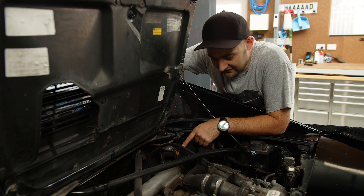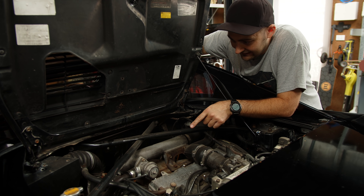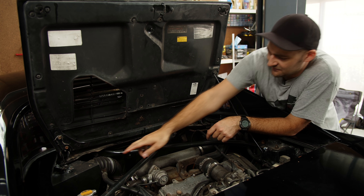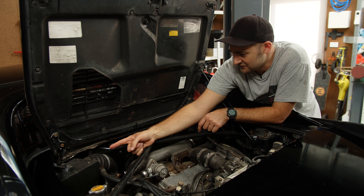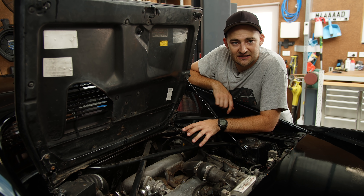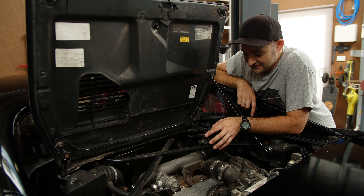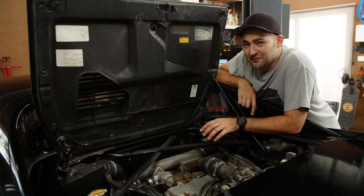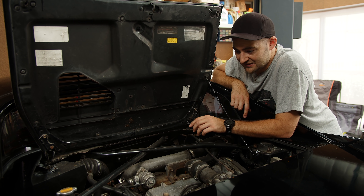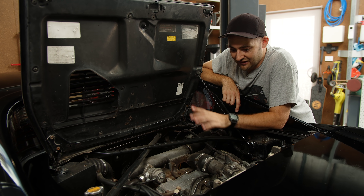Stock turbo, as far as I can tell. It all looks very factory, but someone has put a bleed valve on it, and I'm pretty sure that's an aftermarket blow-off valve. And some kind of boost control — they've gotten rid of the factory boost control. And then there's something going on here too with this intake. I think it's got an old school style vane airflow meter. My mission with this: because it is actually getting hard to find upgrade parts for this car, I don't want to spend a month trying to make a turbo fit. I'm going to leave stuff that works and fix stuff that doesn't — like that airflow meter. The idle is junk. The part throttle is junk. The boost control is not very good. I want to fix all that and just make it really nice to drive.